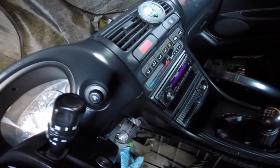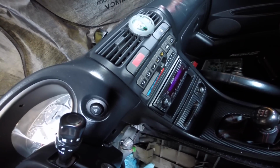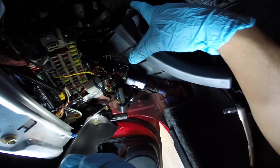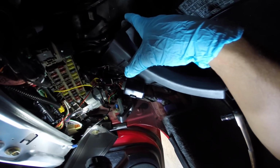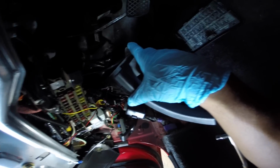So when you get your oil change or when it requires a maintenance check, if you push the button at the bottom here, it turns off the maintenance light. So I got all the panels out of the way, you guys. Gotta unscrew that bolt right there. It's a 10mm bolt, and that should take out the main relay. After that, it's pretty much just plug and play.